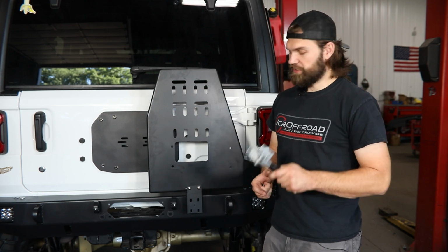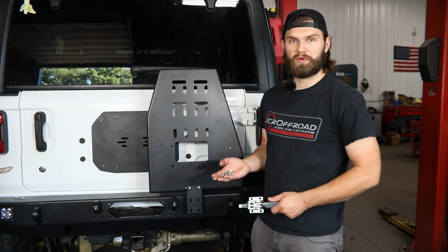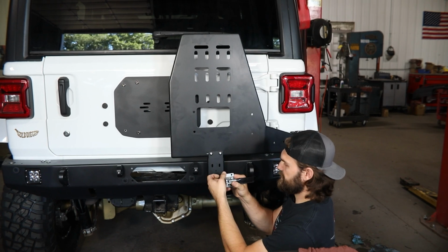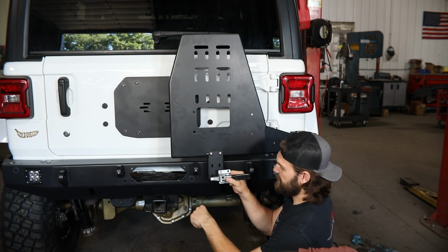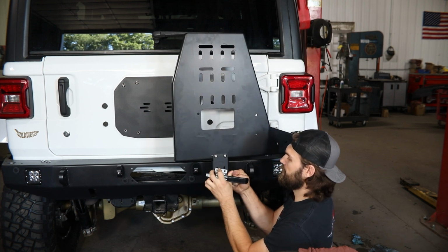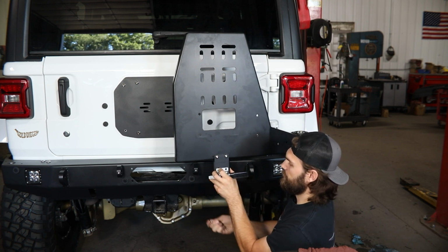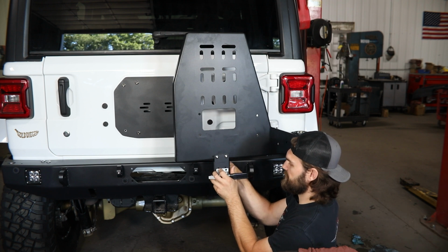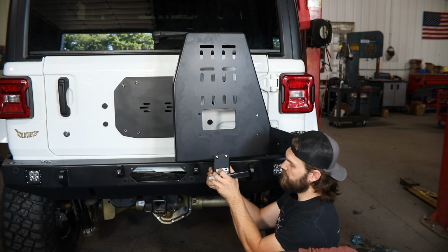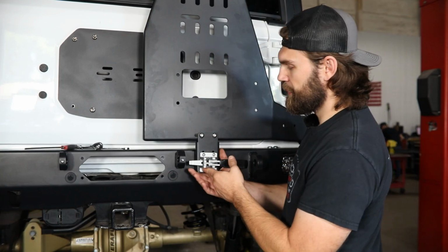After that, the latch can be installed to this bracket using these 4 slots and 1/4 button head bolts and flange nuts. You're going to want to install this obviously so the handle's toward the outside, and this catch will hit right there in the latch bracket. And then we're just going to get all 4 bolts started and threaded in by hand again before making final adjustments.